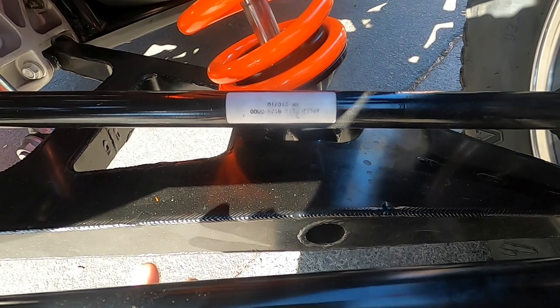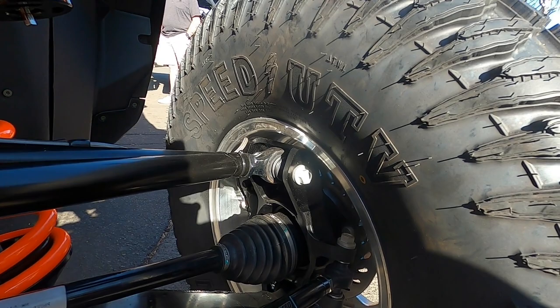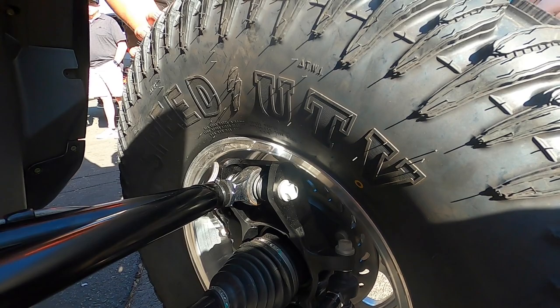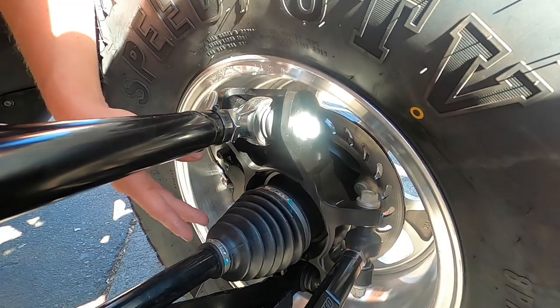Taking shots on Can-Am. Obviously, I have a Can-Am, but this is next level stuff, and what they're building is heavy duty. We're looking at the hub or the spindle right now. What would you call this? Obviously, it's dual captured on both sides. Yeah, so everything we do is in dual shear. This is our full hub assembly. And again, everything's the same on all four corners. Same rotors, same calipers, same hubs, same wheel bearings. The hubs are the same? Hub's the same left to right.